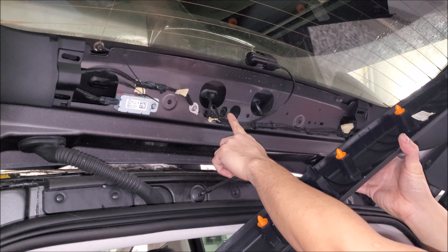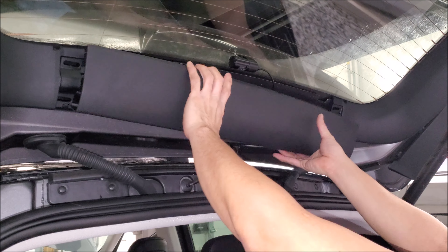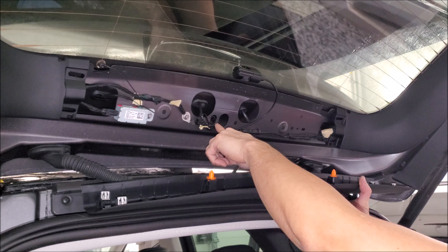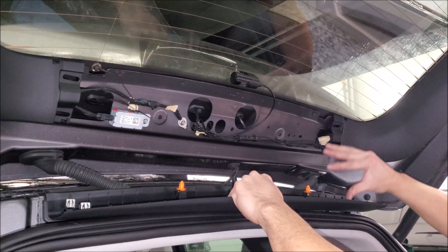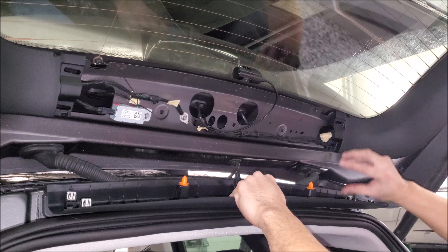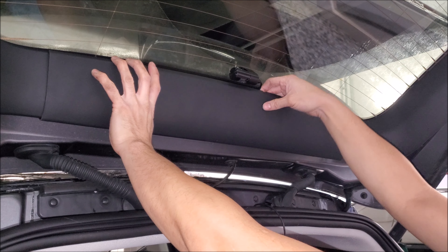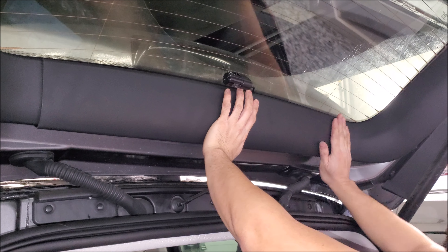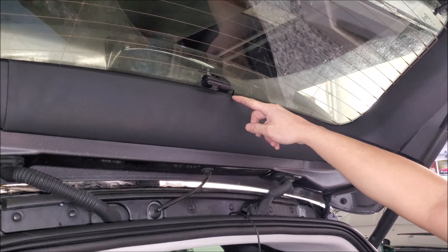Here are the tips for your wiring. Always run with the factory wire because you know it's designed to go there. All these holes do mean something — you can see we have a guide tab here and push pins, so we can't get the wire in the way, because if it's in line with those and you go to push the panel on, you can cut the wiring. We've also left a little loop here just for servicing. There's another loop because this area articulates all the time, and if it's tight you can pull and tear the wiring. I've also notched the panel so the camera wire is held in place, and because it's so tight to the glass, if we don't notch it the wire can chafe there as well.